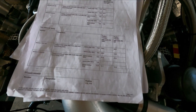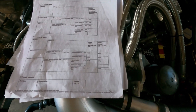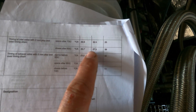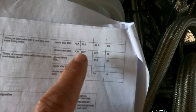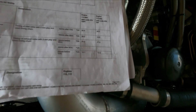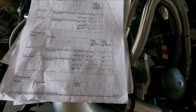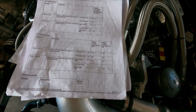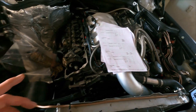It has something to do with the SAS system, of course, because this cam does not have it - it will go 14 degrees later. So if you imagine this one is going to 28 degrees and this one is going to 30, that's only two degrees difference. But later it's 25, so you can say it's around 13 degrees difference in closing the intake valve. So there's also less air getting into that cylinder - it doesn't work the same. So if you ever want to do a turbo build, don't use these cylinder heads with the SAS system.